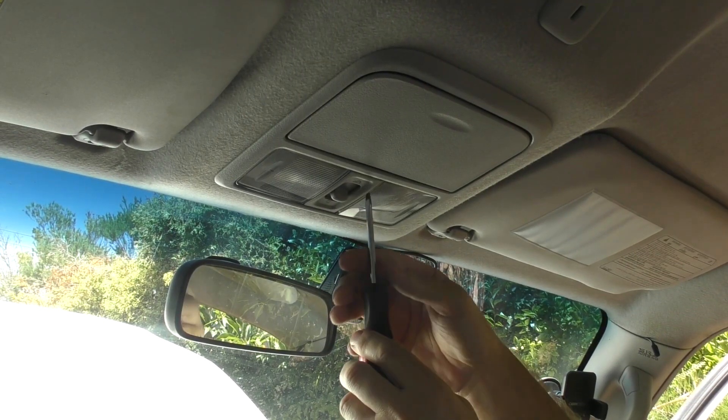While we're here, let's race around and I'll show you the other globes. I can't remember which ones are T10s and which ones aren't, but I'm going to show you how to get to those interior globes and how to change them, and we'll identify which ones are what. You'll basically just need a screwdriver for most of this stuff. These interior ones I've already changed to LED - I'll show you what I've gone to and put a link in the description. A lot of these are a festoon globe, not a T10 - I think the ones in the door are T10 but the interior ones up here are a festoon globe.